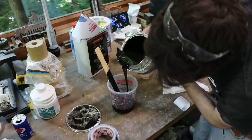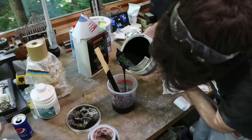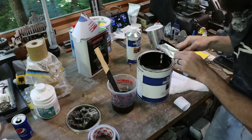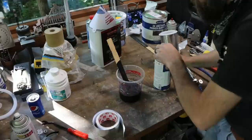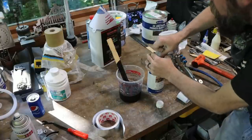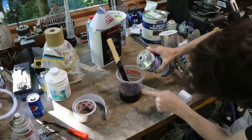So I don't want to mix up too much. Probably do this cab in a couple sprays. So we'll go up to the number 3. Wow, I can't believe that that worked as good as it did. So last week I showed how to use these cups. Extremely easy. So this is a 4-to-1 mix ratio, just like what we used last week. And since we went up to the number 3, we're going to go up to the other number 3 in the second column.